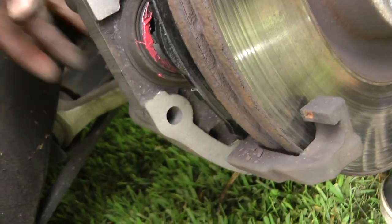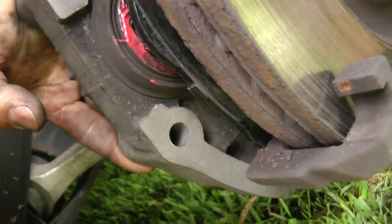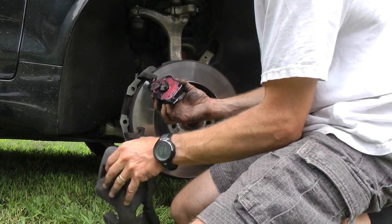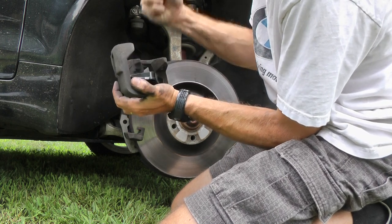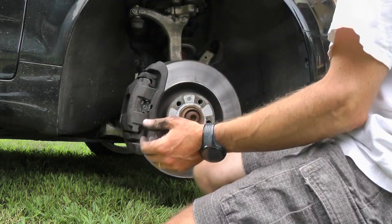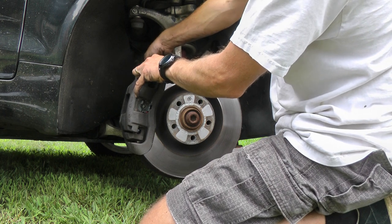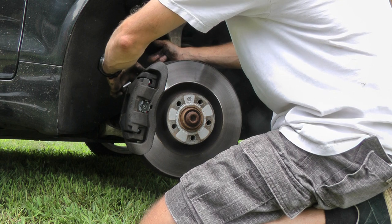When you put these brake pads in, put it into the carrier first, and then you have to slide this on these pins on this caliper and squish it so it snaps into that hole. On the front side you're going to want to clip this into the carrier first, which is different from the back. Don't get grease on the top or on the disc. This should be able to just slide in like that. Now we're going to put our bolts back in. I got my sensor hooked up, but I needed to tighten the bolt before I put the sensor on — so I'm still learning, but you don't have to make that mistake.